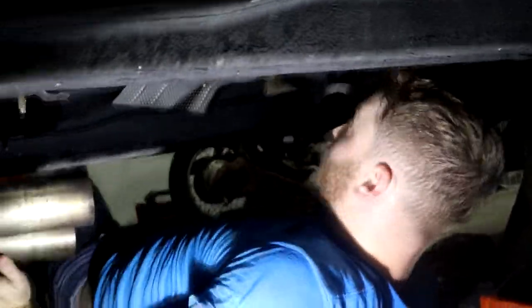We've got two bolts left and this U-clip right here, or U-bracket or whatever, that holds the center of the drive shaft up. So this side's a little difficult to get to. We've got the e-brake that goes right through here. So what I did was I got the 13 with a swivel socket on there, or swivel extension thing, and then I was able to get it pretty easy. All right, she came out. All I did was jiggle it a lot, and she eventually came out. Super heavy, super not fun.